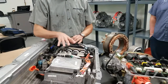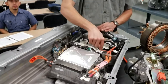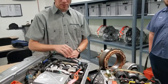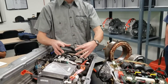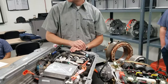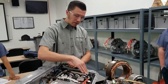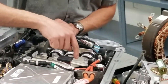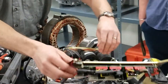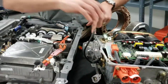It uses that in combination with the position sensor, the encoder resolver, and its software commands to determine applied torque. Number seven: underneath this black case right there are the IGBTs — Insulated Gate Bipolar Transistors. This is where the magic happens — the flux capacitor of hybrids and electric vehicles. That's what rotates the field; that's what actually inverts DC to three phases. The DC comes in, goes to the capacitor bank, then into the IGBT where it gets inverted into three phases. The Toyota has two sets of IGBTs — one for each motor generator — while this Honda only has one set because it's a single IMA motor in a parallel hybrid configuration.